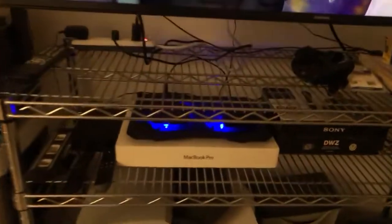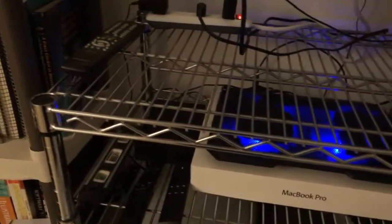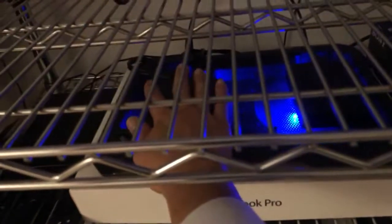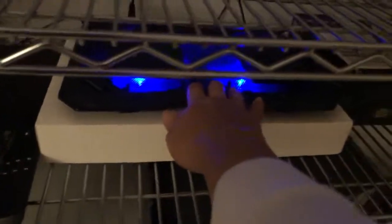In this configuration, I'm using a USB adapter to connect the Ethernet cable, and I've hooked up the hard drive. Some of the content streams over the network. So this is a fully loaded Mi Box and it uses about 10 watts. I can run it for hours and hours. It's not hot at all — it gets a little warm to the touch. Without the cooling pad it could get pretty hot. So this is a cheap, $10 solution.